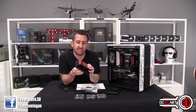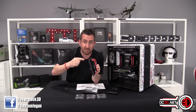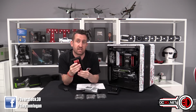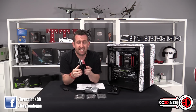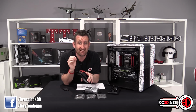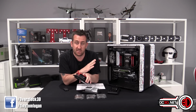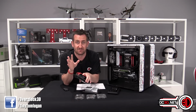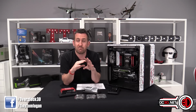I couldn't even get it running with it on XMP and then turning the memory timing back to something like 3000. It just wasn't having any of it. There's nothing wrong with the memory, nothing wrong with the board, it's just little BIOS glitches at the moment. And it's not just this board that I've seen it with, because I've been doing a lot of testing on boards in the last few weeks, which is why I've been quiet. Essentially we're waiting for that final BIOS to come out.